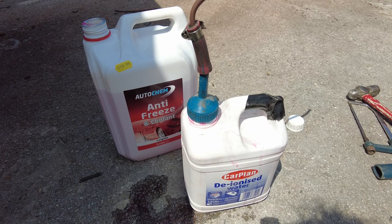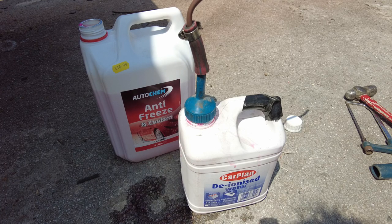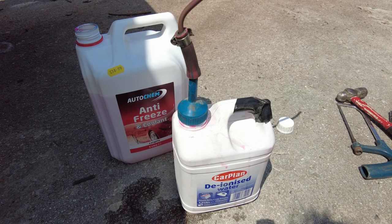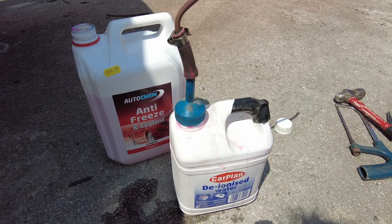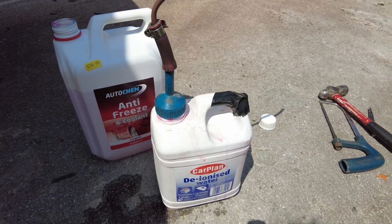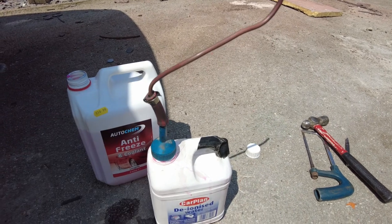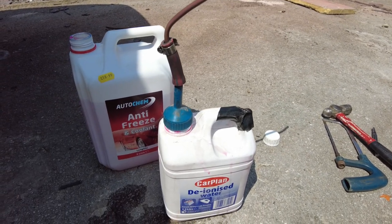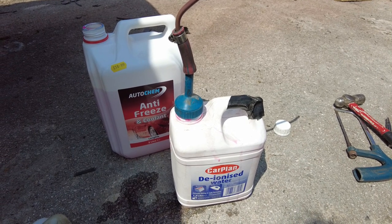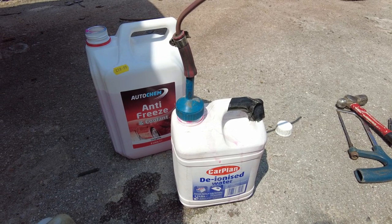I need to refill the van with coolant now. I personally use the pink 5-year glycol — it's the best option for anti-corrosion, though it's getting quite expensive these days. It's quite awkward refilling the radiator from the front, so quite luckily I've got this old fill bottle where the top actually goes onto the deionised water bottle. I've made a little pipe out of some copper pipe which goes into the radiator. We're going to be very patient and refill the radiator from the front, topping the bottles up at the back. There's a little bit of water in the system already so I may go a bit heavy on the coolant.